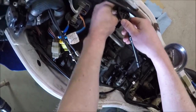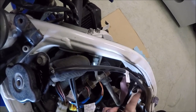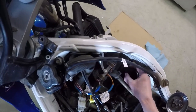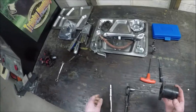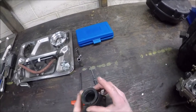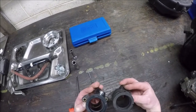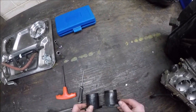These intake boots are worth noting — they are asymmetrical. There's rights and there's lefts. I don't think all four are different, but the rights are different and the lefts are different. Both bolts are out — there it is. Let's take a look at this thing. Holy shit. This thing was going. The inside looks all right — it wasn't leaking air yet. The outside was clearly deteriorating. This is a new one, this is the old one. Yeah, this is the right diameter. That's why we're going in and replacing them — that is no bueno.